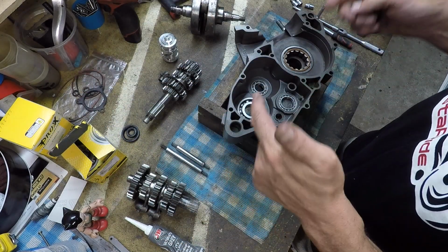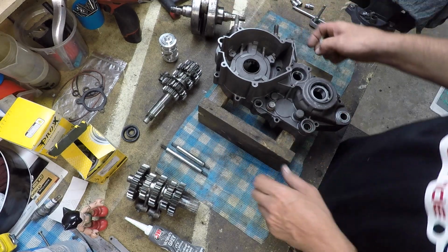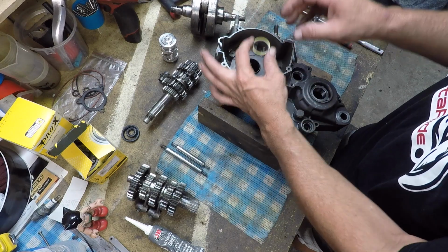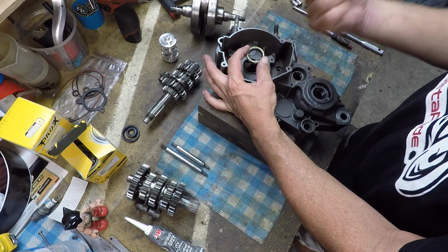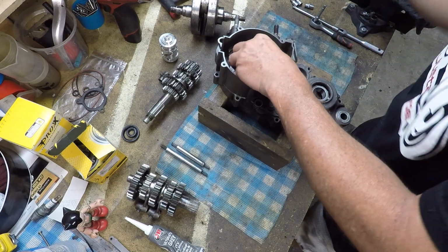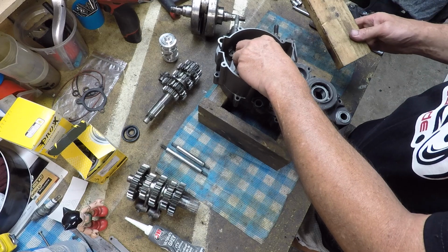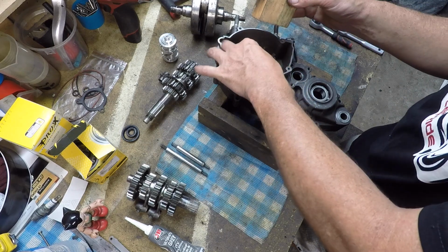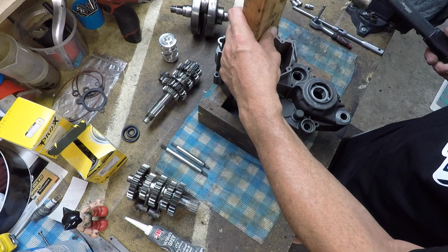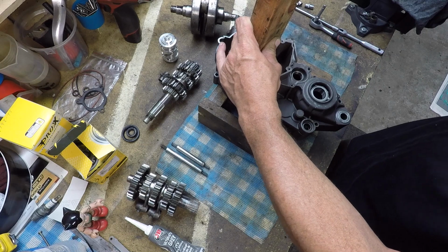I'm going to put the dust seals in first. In the past, I've not done this. I've put the shaft through, and then you try and put a dust seal in place with a shaft that's already on it. It can be a bit troublesome. So it was just a conversation I had in passing with Andrew from Full Noise, and he didn't outright say it, but what I gathered from what he was saying was, this is kosher. Seals on first.